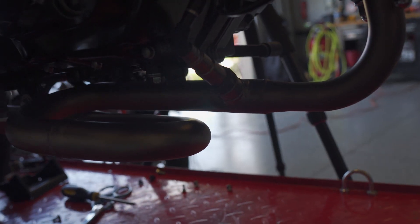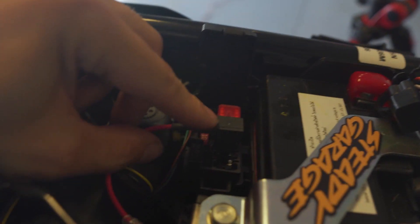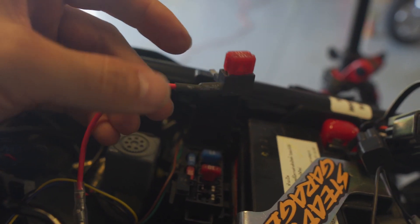Next day - I had to take a break; it was getting way too hot in the garage yesterday, and I had to stop by the auto parts store to get some fuses. Here I have the sensor going into the Yoshi exhaust, routed up along the side of the bike and up into the under-seat area. I also found the grounding point where all the other ground leads come in. For power, I'm using a piggyback fuse tap on the 12V DC fuse - it keeps the existing fuse plus adds a new hot line with its own fuse to power the AF1.